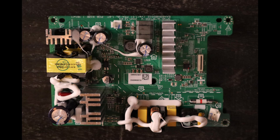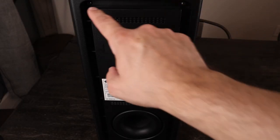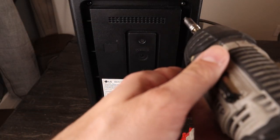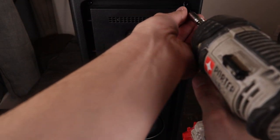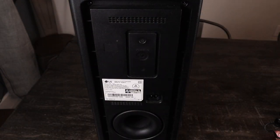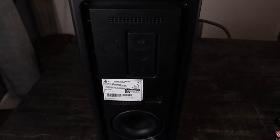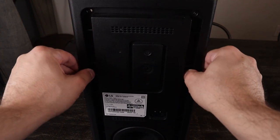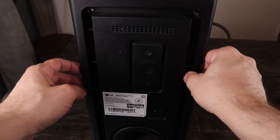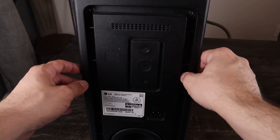It's almost identical to the original except for one aspect which I'll show you a little later in the video. Now to disassemble it, there's eight screws — two at the top, two at the bottom, and then there's another four in between. First thing you got to do is just remove the screws. I already removed all the other ones, I just left the top two and you just take them out. After the screws are out, just grab it and slowly pull out but don't force it out because it's being held on by a connection. There's a wire that's clipped into that PCB board.